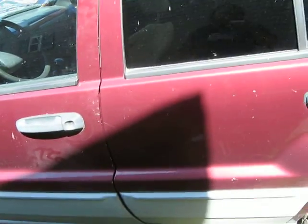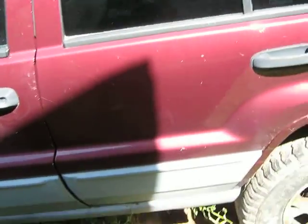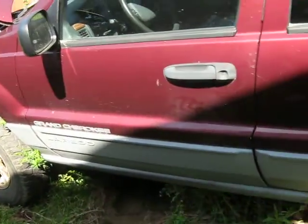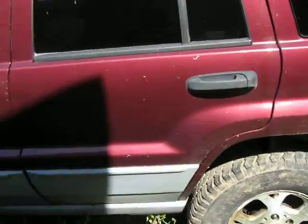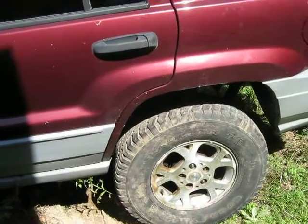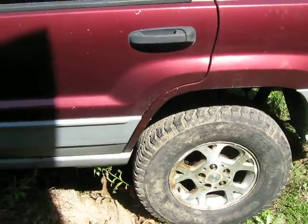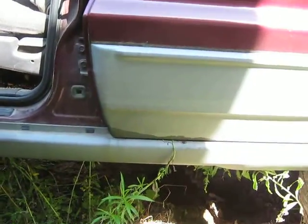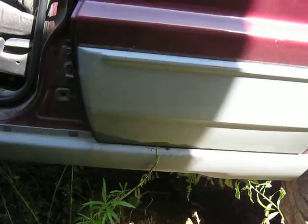I can't wait to get this thing rolling. It's nice to see wheels on this side — it's been four years since this thing's seen wheels on it. I've got the other two tires down next to the others. These tires are not going to stay on this — I'm not going to drive this with these tires. They're all dry rotted and they're way too big. They're 265/75/16s — way too big for this Jeep. The factory size is actually 225.